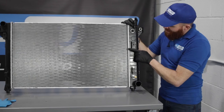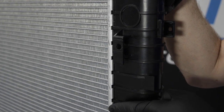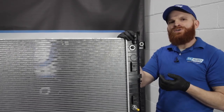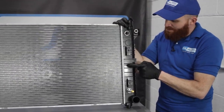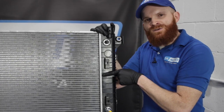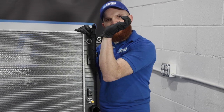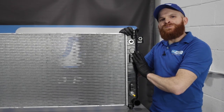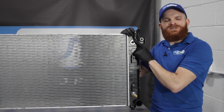Generally speaking, these tanks are made out of plastic because it's light and easy to form — you can make it look however you want. This is the area where the aluminum meets the plastic tank. Generally, the way they do that is they have these little crimpies and they crimp it over the plastic. Of course, there's a seal in there, and that's very important.